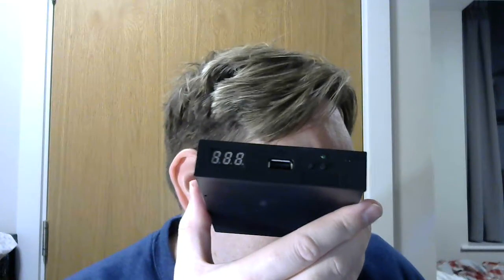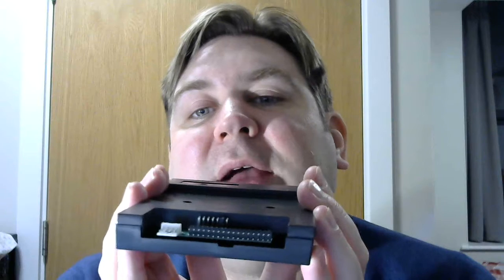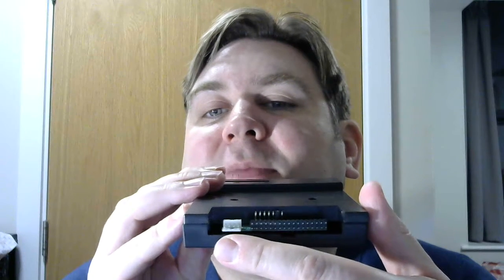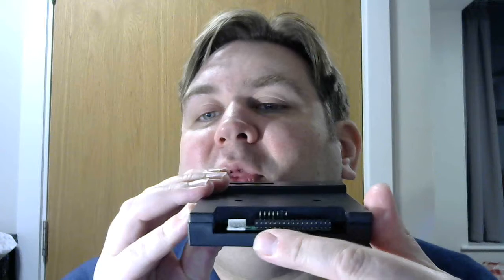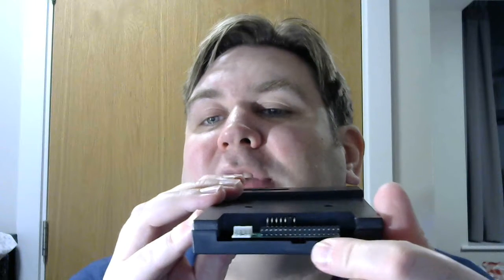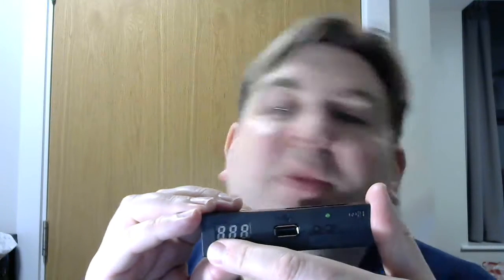The kind of systems that need these also have BIOSes that don't like having a floppy disk in the drive if they're not booting from it, so this comes in and out as well. On the back of the device, the reason we always mention there's no floppy disk drive connector on the board is that these actually interface with the traditional MFM floppy disk drive connector. The power is a four-pin floppy connector — you can get a Molex adapter — and the data connection is a floppy drive data connection. You don't get a cable with this, but most motherboards include a floppy disk drive cable.